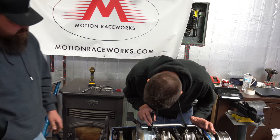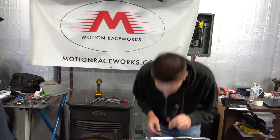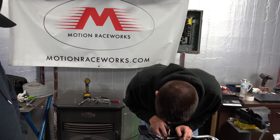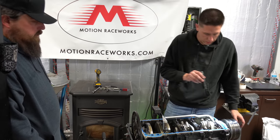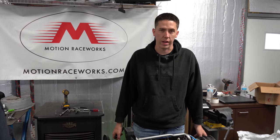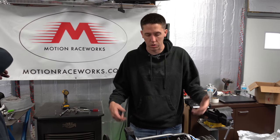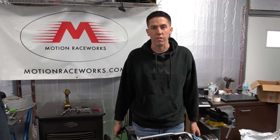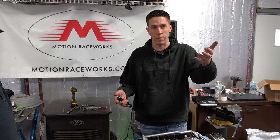Six had a bad plug in it, and five looks like it melted. From this side of it, I can't see any melted piston on six, which is a good thing. We're going to have to at least fix five and go from there. In the next video we're going to tear this engine down and get a real close look at exactly the damage — start pulling the piston out, look at the cylinder wall, and see if it hurt the block real bad. If you want to see more, make sure you hit that subscribe button.